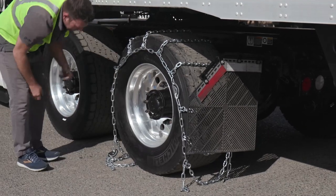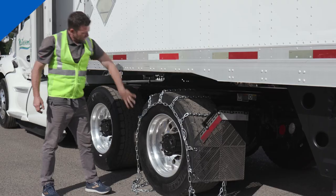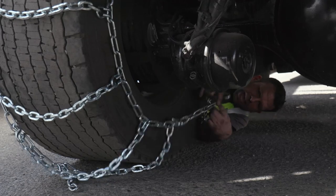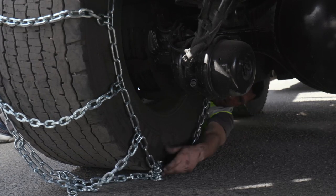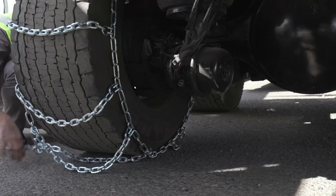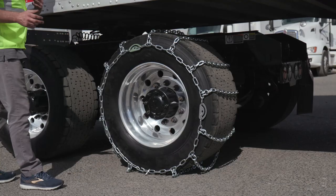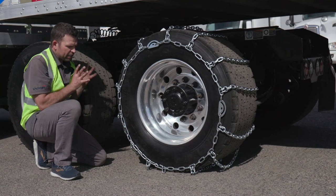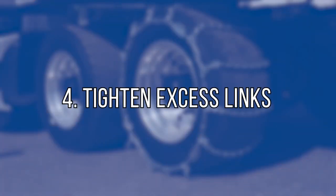At this point, I like the way this is centered. I'm going to start by tucking the tail end to the backside. We always want to work from the back to the front. I'm going to loosely attach my speed hook to the tag chain here just to hold the chain on as we rotate the vehicle. Then I'll move to the front of the tire and loosely fasten it there as well, just to hold the chain in place. We'll then get into the vehicle and back it up to get the connection points into a safe working area.